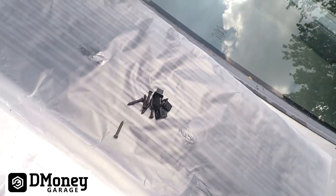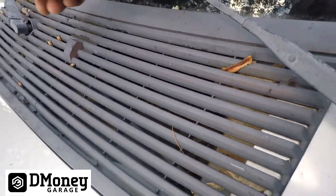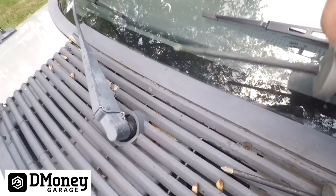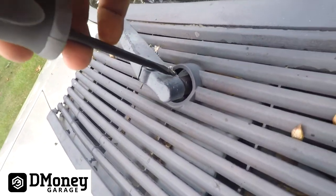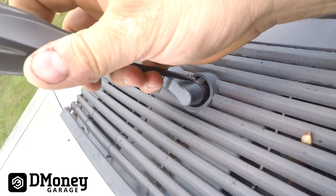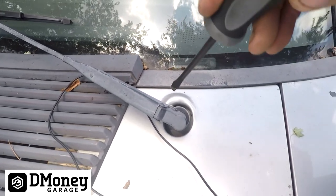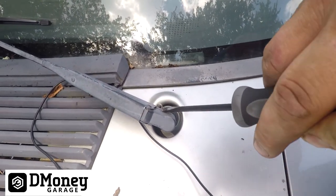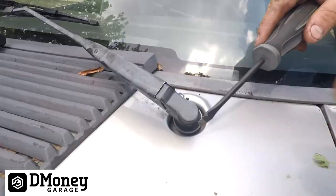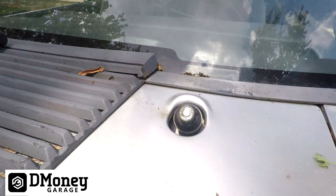So now we're going to go up front and get all this stuff taken off. First thing you have to do is take off the wipers — this one and that one. Take them off; it's actually really simple. There's a little deal there that you just pull out. See how that just kind of pulls away from the center — just needs a little persuasion, just like that. Then do the same on the other one.